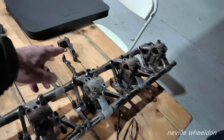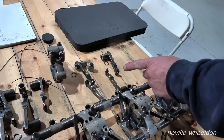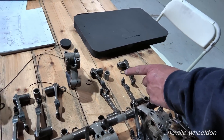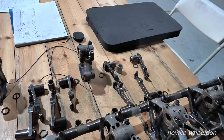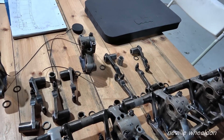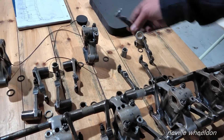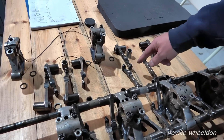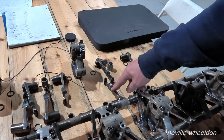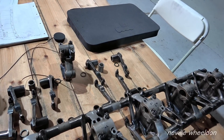A left-hand cam can be fitted in certain positions — it can be either a left-hand exhaust or right-hand inlet. The same cam shape opens and closes the exhaust on one position and opens and closes the inlets on the other, because the inlets are on the far side.